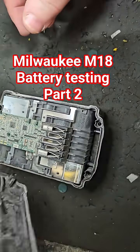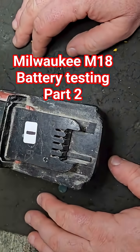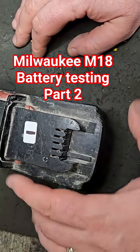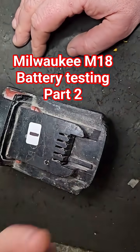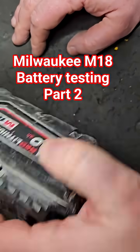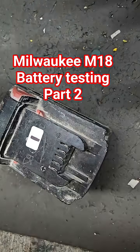What I would say about that, and what the possible attempt to fix would be: I would say we could try voltage recovery through the DC power supply. Or if you want to do a crude method — jump start — but because these are so low you're likely to fry at least four of the cells doing that. So trying it in the DC power supply would be my solution for that. So that's one down.